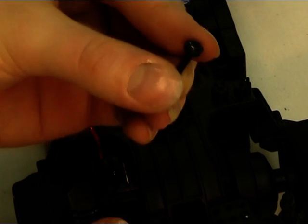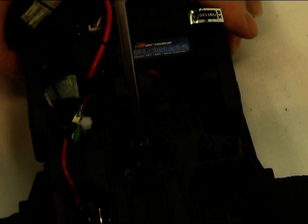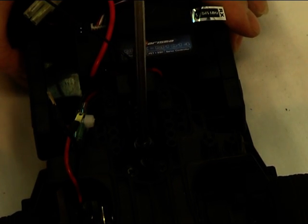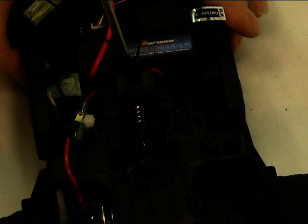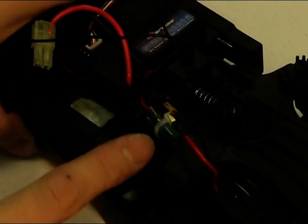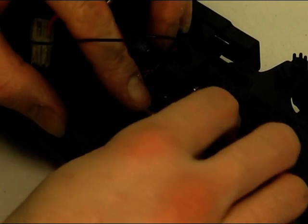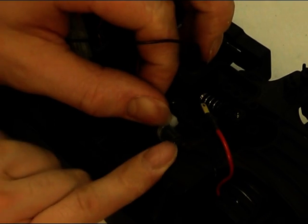And remember that this screw had an O-ring on. It goes in the front. Again, you can now slide that on the stand. Tighten that down, and remember to tighten down the front screw also. Just check that that pod runs free. Now we need to connect up the motor wires that are here. At this point, make sure you get your colours the right way around, so obviously black to black, and they should push in so there's no metal showing after the connectors.